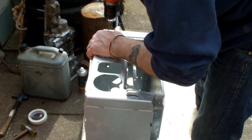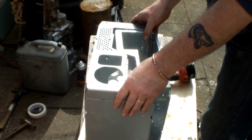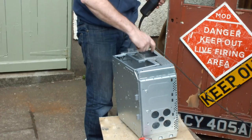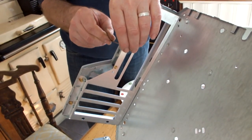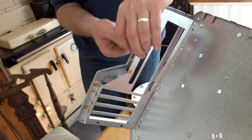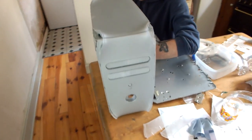It's back to following the LaserHive instructions for the holes being drilled for installation of the new backplate. One last tiny bit is chopping away the piece of restricting metal by the power supply to allow us to use an ATX power supply more easily. That's the last bit of metal we're chopping out of this case. Moving indoors, we are done with the drilling, grinding and all the dirty work. It's now just a case of putting the system back together. You can see the laser-cut metal back panel from the LaserHive that will act as the new support for the I/O shield and four expansion slots. That's one thing to note - you will no longer have five expansion slots in your Quicksilver, only four, which is the MATX specification.